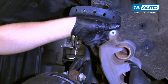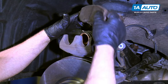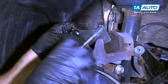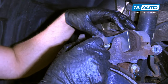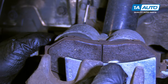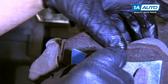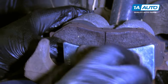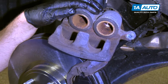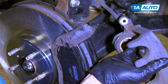Take our caliper, flip it upside down, shake out any rust. I'll take one of the old brake pads, slip it right here, and use a caliper compressing tool — you can buy these at 1aauto.com. This is only a single piston caliper tool, but using the brake pad we can alternate back and forth to get it to go down. Just slowly compress the caliper. You could also use channel lock pliers or a C-clamp to compress it. Now the caliper is compressed all the way — pull this brake pad off.